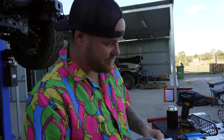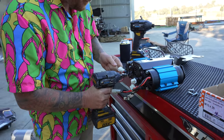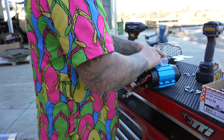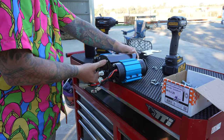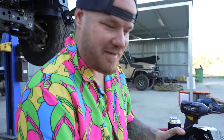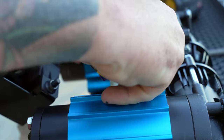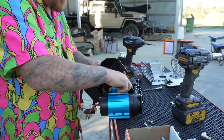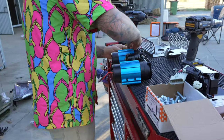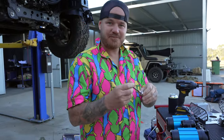We were pulling this apart. Ten mil, these four bolts. Then look at that bit of goodness there. Everyone say it with me: yellow right, purple left. Yellow towards filters, purple towards the back. I'm going to get that wrong so we can rewind the video - got it on camera. The Allen key to undo them was a four mil. Four mil Allen key - we need that again.